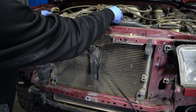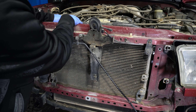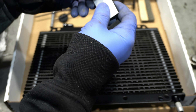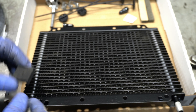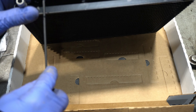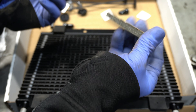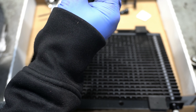With the fans out of the way we can push the radiator back, giving us room to reach behind and connect the clips on the backside of the cooler. We need to install the foam pads to stop abrasion between the two metals — pretty straightforward, just rip them apart. We'll line them up right here so that when we push the hangers through they come through correctly. I had two extra pieces of foam so I'll throw those on as well.